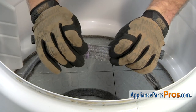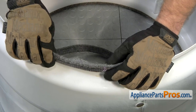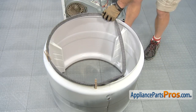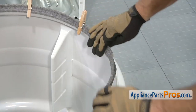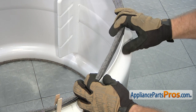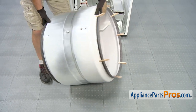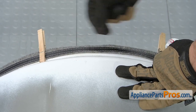Now that we have the felt seal sized, we're going to open it up and put it over the drum lip, making sure that the black material is on the outside. We're going to put a clothes pin right here and then work our way around, putting a clothes pin every so often. Once you get to the last section, you may have to use both hands to kind of come together and get it over the lip of the drum. Now that we have the felt on, we're going to lay the drum on its side so we can put the glue on. We're going to go around and lift up the felt seal lip, put the glue in there, and move the clothes pins as we go around.